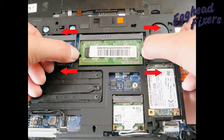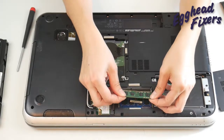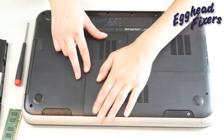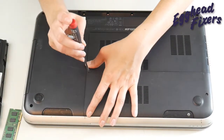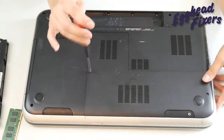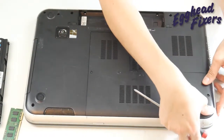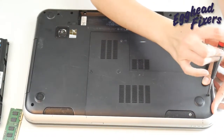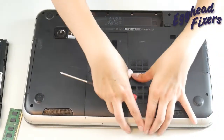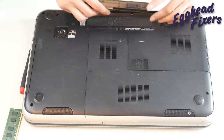We're going to remove one stick of RAM because RAM is like a headlight on a car — they tend to go one at a time. So we're going to see if it works with just one stick. We're going to close the computer up, put that panel back on, keeping in mind there's only one stick of RAM. If there's one stick of RAM in there and it works, then you know it's a problem with the other RAM stick.